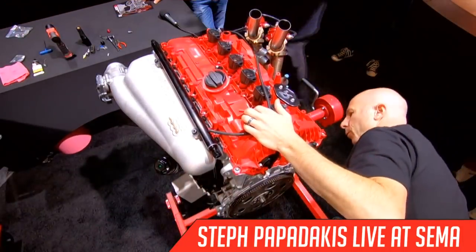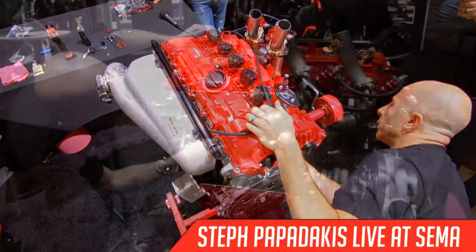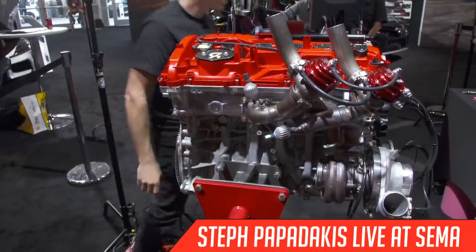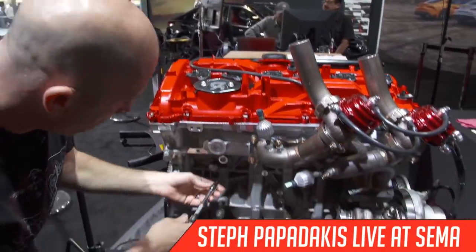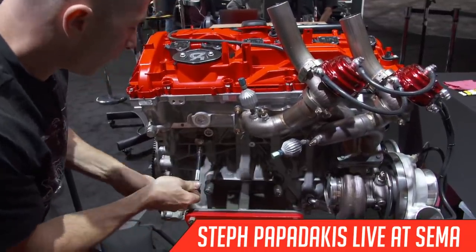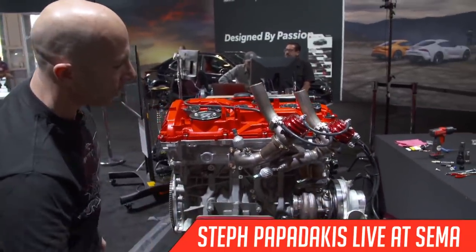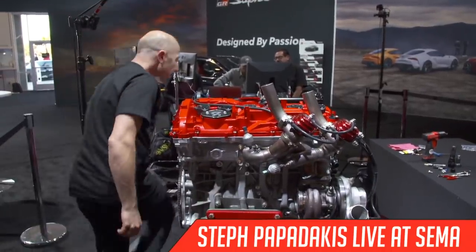This one is part of the turbocharger cooling lines, but we're not running coolant through our turbo. We're only running oil. It's not always recommended, although we've had fine results running only oil through our turbochargers. But for endurance racing, or even street driving, when you park the car and it's hot, the coolant can help keep the center cartridge cool and make the turbocharger last longer.